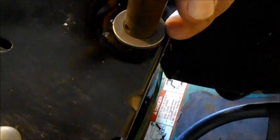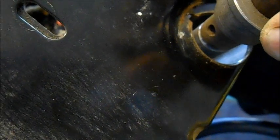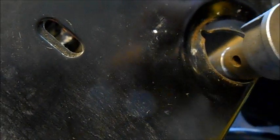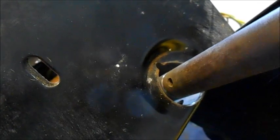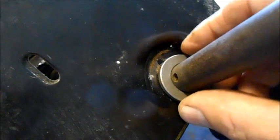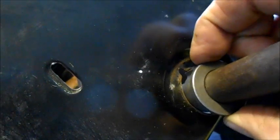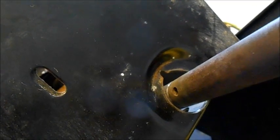This bushing was actually — it's so hard to do with a camera in your hand. There we go. It was actually floating up like this, causing this shaft to roll. And if you look there, the actual shaft has got a wear mark in it from rotating around like that. And now, with that hole being oblong right through here, even with the bushing in, it still has a fair bit of slack because the shaft has worn an oblong shape into the column right here.